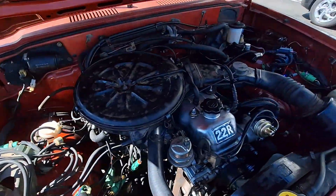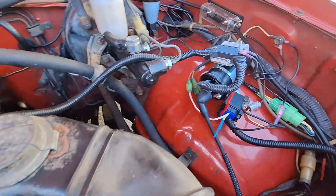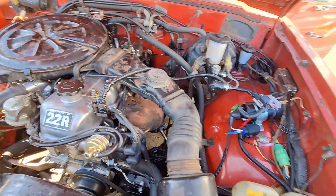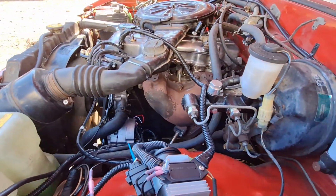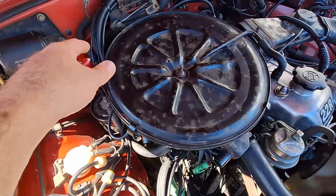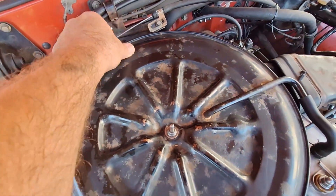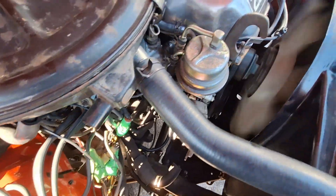This is my 1981 Toyota pickup with a 22R running off of a 4-pin General Motors HEI ignition module to replace the original Toyota igniter, which is out of production. Many of the aftermarket igniters aren't very reliable, but HEI units generally are, and are quite cheap, but a little confusing to retrofit to a 22R if it's your first time.